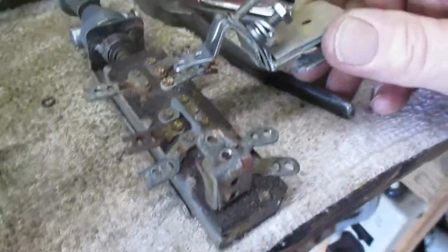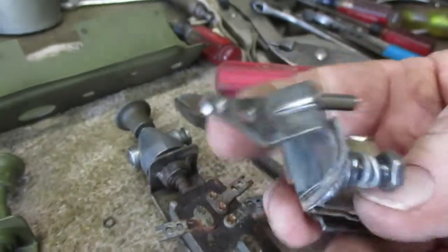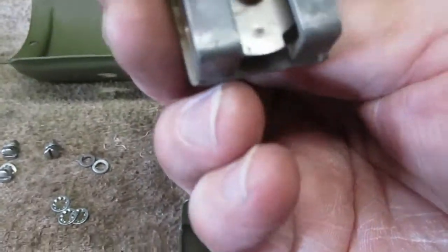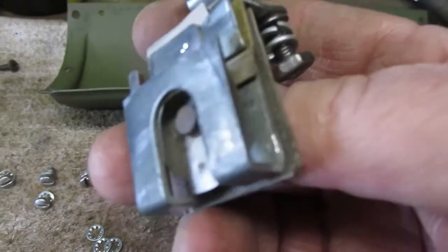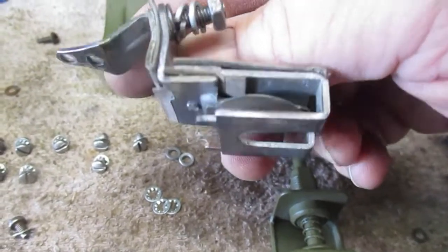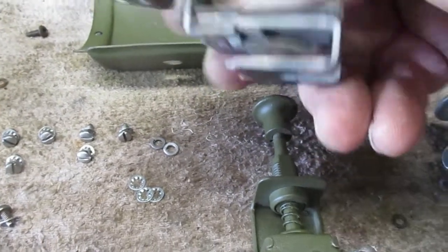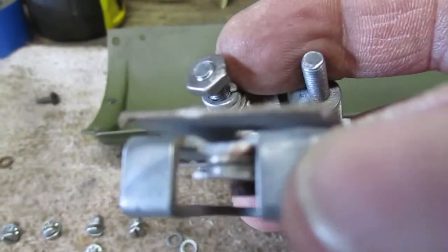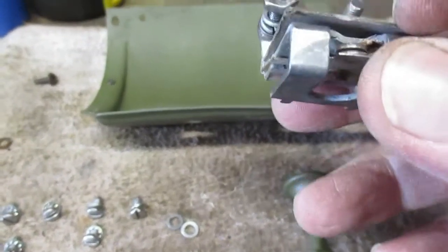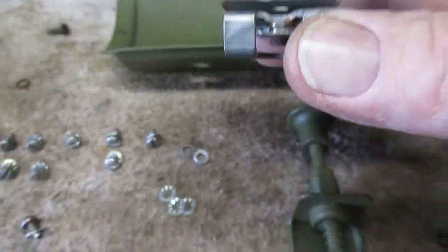Also, this light switch had this circuit breaker. Back then they didn't have the fuses like what you'd see today. In the middle there's that plate. It's very thin metal, and when it gets too hot, what it does is it distorts and breaks the connection, the electrical connection right there in the middle. That will open up. It's pretty hard to do. I can't do it one-handed. And then everything gets shut off.